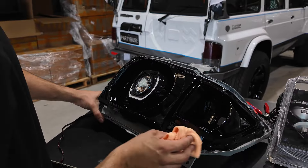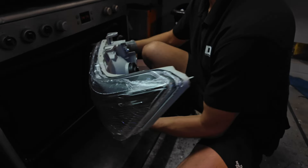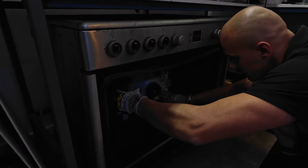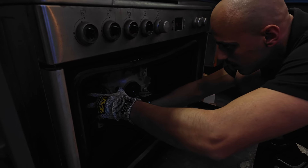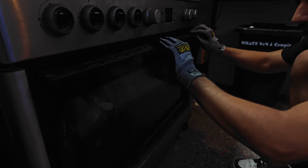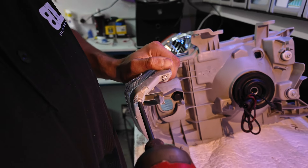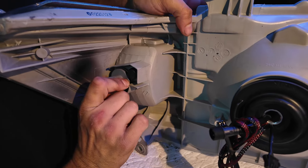Secure the lens as best you can by pushing it in place, but it will need heat from the oven again to soften the glue and seal properly — same steps as before, 100 to 120 degrees for four to six minutes. We can then work the lens back in place; take your time working each edge while it's nice and soft to make sure it seals well. Then re-fix the screws, stick the globes back in, and it's ready to be installed.